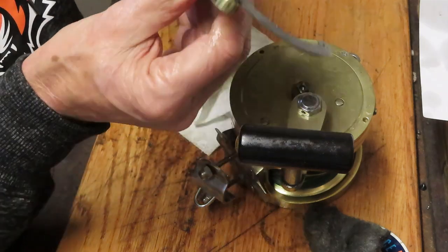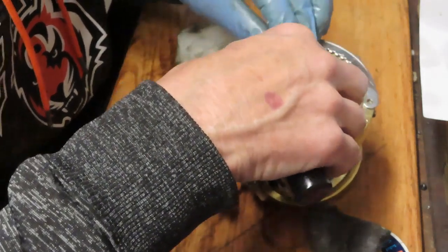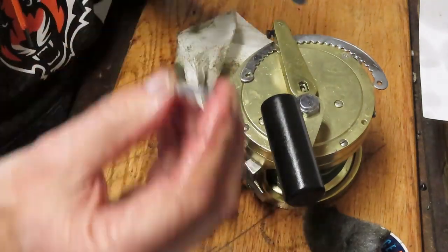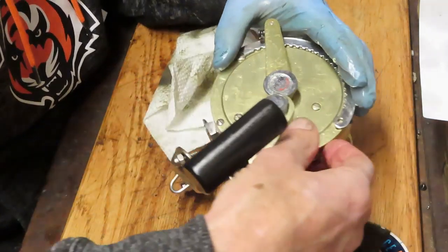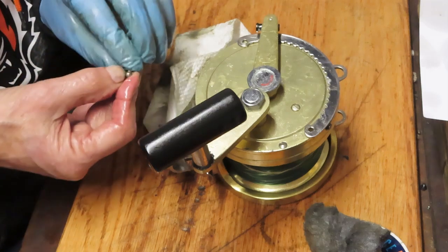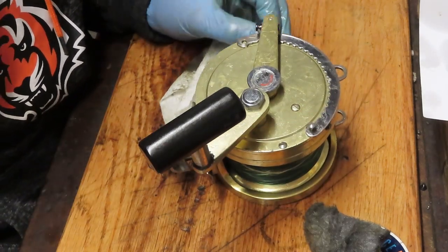Let's bring the slot into the trim ring. Put this over the side. Like that. And if you like, start the screw so that you don't lose that lever. Then slide the trim ring in place. There's two more of these. One goes in each side here. And that's where I've used that little nut driver with the 3/16.